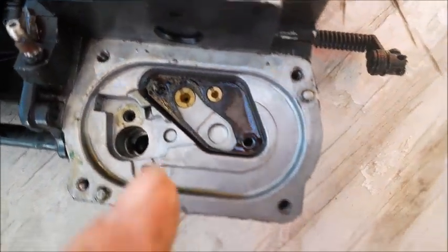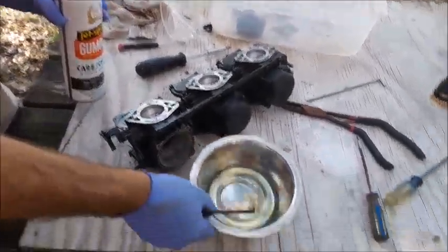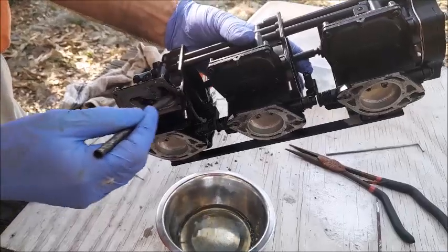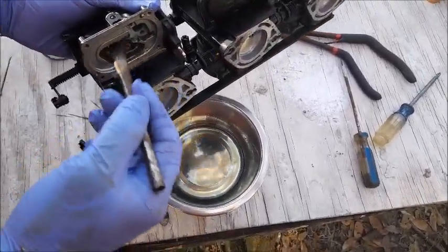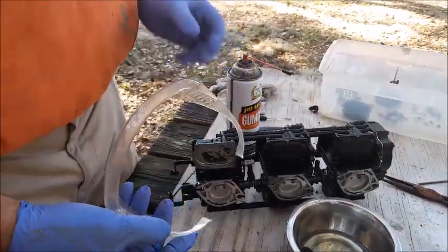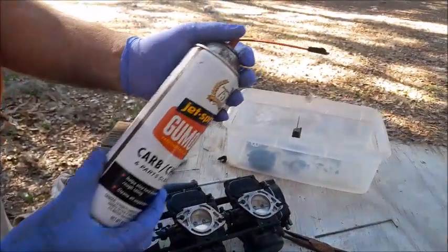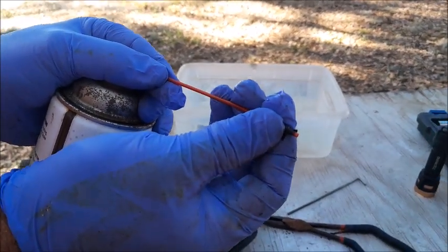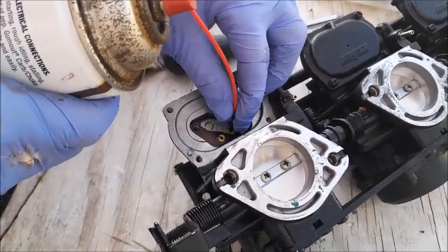When you look down this side, we actually have two jets that you can see right there. We're going to blow those through with carburetor cleaner. We're going to use a combination of carburetor cleaner and just a bowl of gasoline to clean this thing up — the gas more to clean up larger surfaces, and the carb cleaner to get down inside all the little tubes. It's always important to wear your safety glasses, particularly when using the spray carb cleaner because it will spray back in your face. I like using the one that has a straw on it and I take a little bit of electrical tape, wrap it around the tip, and slide it down that red tube like that so you can seal it down inside the jet.